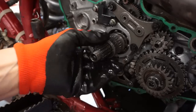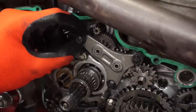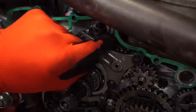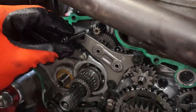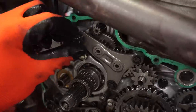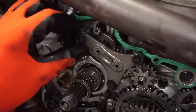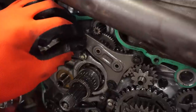This bearing just stays behind there like that. So this is the bolt. Yeah, look at, you can see it just coming right out. So that was out quite a ways, which is not good because that holds that gear on there. See that? Not good at all. That definitely needs to be tight in there. And it was not. We're gonna put some thread locker on there and twist that back in. You know, I wonder if they used too big of a bolt. Nope. That fits all the way in. So they just didn't put thread locker on it.